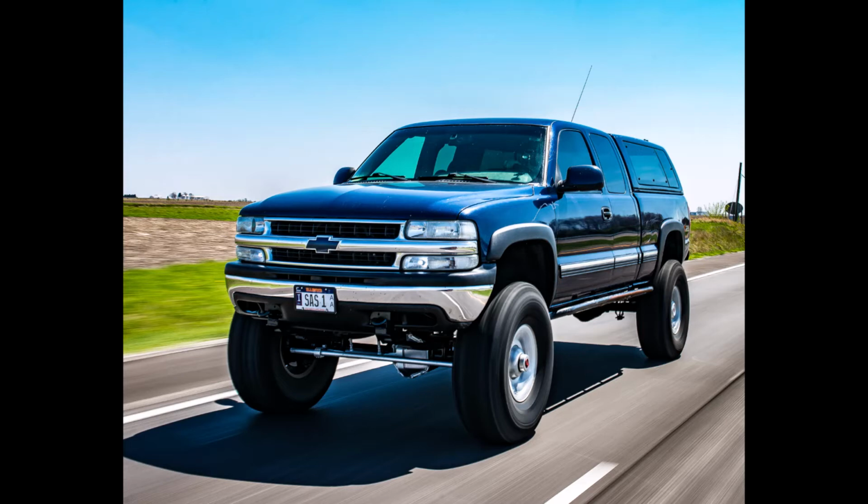Well, did you cut out the center cross member underneath, or how does that work, I don't know on a newer body style. On my GMT 800, there's a bolt-in cross member for the diff. Under the transmission. Oh, under the transmission? I'm sorry, not under the transmission, under the oil pan. There's nothing under the oil pan. So once you took the diff out, it was easy to get the oil pan. Oh, yeah. Okay. Super easy. So that's better then. Yeah, it's not too bad. Especially with no axle under there. It was just 12 or 14 bolts or whatever, and you just pull them out. Pop it on there and torque it down.